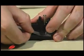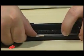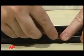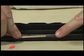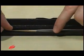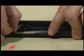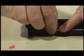Remove the release liner from the recovery blade and install into the waste bin. Align the end of the recovery blade with the location marks near the wiper blade end felt. The edge of the recovery blade needs to be aligned with the outside edge of the waste bin. Ensure adhesive activation is made along the entire length.